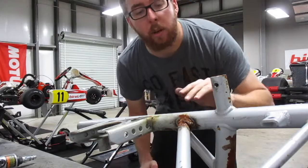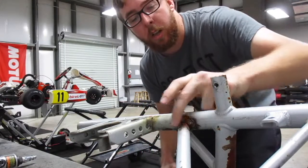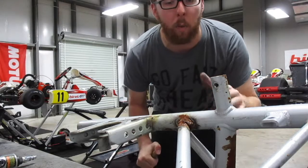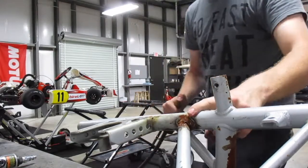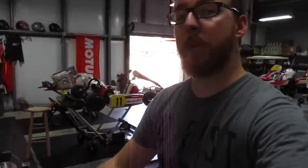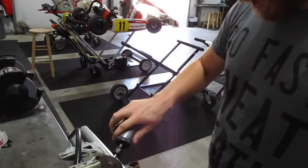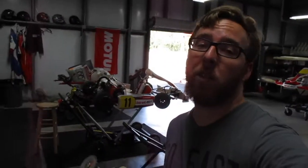The other thing I want to do today is address this broken section. What I'm going to do is clean up the welds — this whole weld area — and prep it for welding. You want to make sure you have a clean surface before you go ahead and apply the welds. Just a side note: I know I should be using a sanding wheel when doing this, but right now all I have is this disc cutter. When you're doing that, make sure you're making real shallow passes and not going deep. All you want to do is take off those old booger welds that have now rusted out — light passes. Hopefully I'll get a sanding wheel today or tomorrow and then we can finish it up properly.